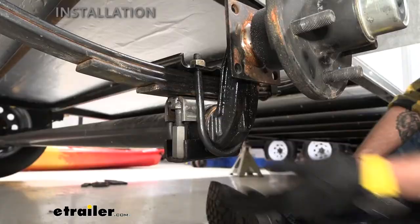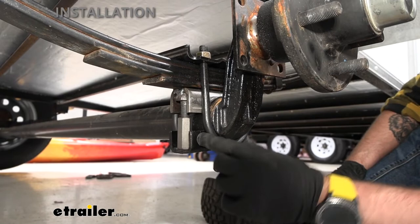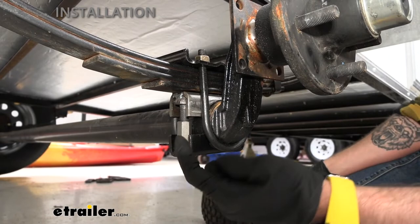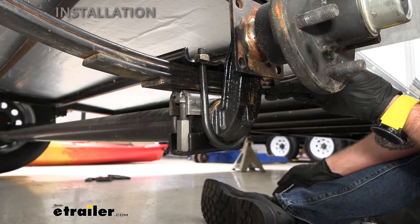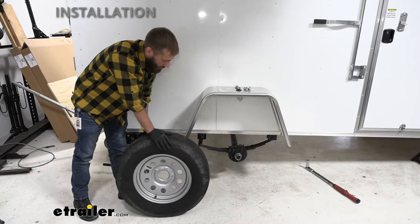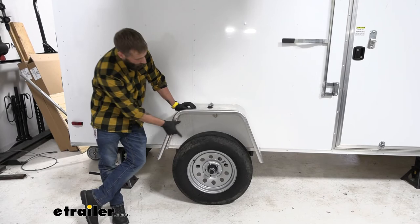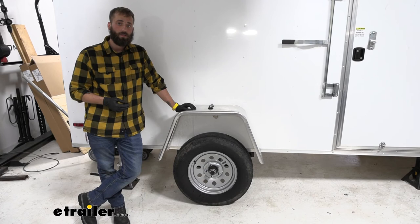Here's our completed conversion kit. Looking at our side by side, we basically completely flipped our system — the bend of the U-bolt used to be up here and now it's down here. So you're going to gain the diameter of your axle as well as your leaf springs so you can get your trailer sitting a little bit higher to handle all those clearance issues. Now that we got our system in place, we can put our wheel back on. Now that we have the trailer lowered back down and it's sitting on the wheels, we have clearly a much bigger difference — a way higher ride height. That's it for this installation. My name's Kevin, thanks for watching guys.